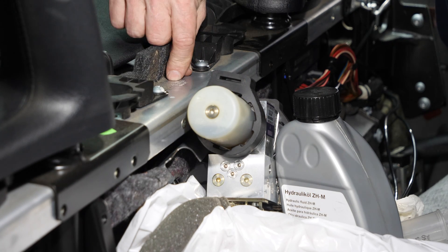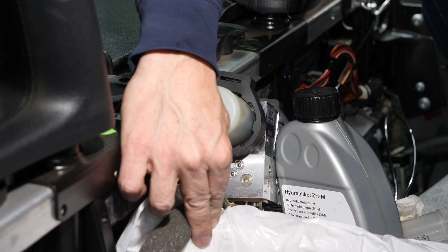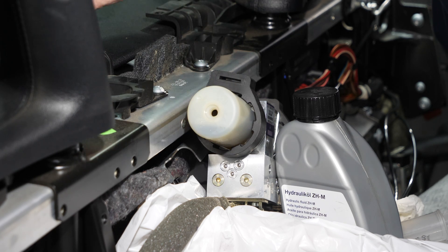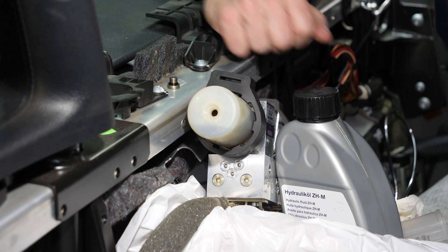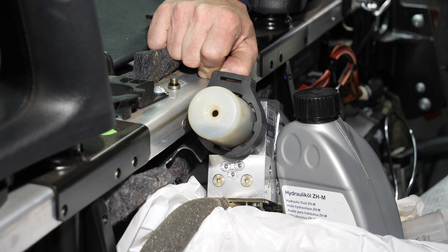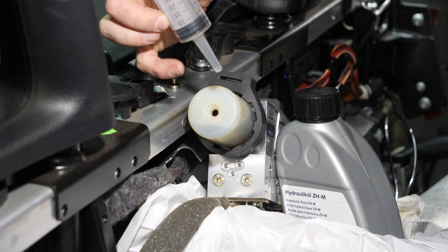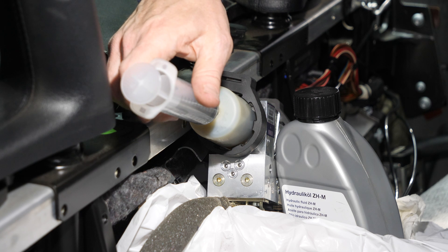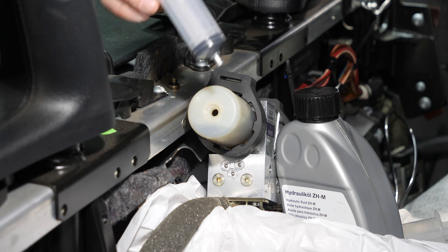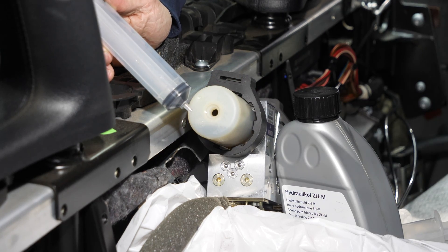We've put a plastic bag under the pump just in case we spill fluid — don't want to smell up the car. I've made the job a little easier by putting a 2x4 under this end of the pump so that the reservoir sticks up. When you remove your fill plug with a 4mm Allen wrench, you'll notice the fill hole isn't terribly big. Your choice of syringe can make the job easier. A squirt bottle with a narrow spout works well, or a catheter-style syringe, or a syringe with a smaller tip. I took one here on which I trimmed the shroud around the tip, and that should work pretty well.